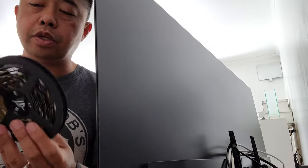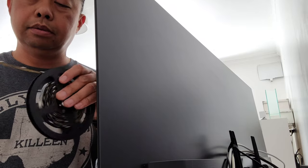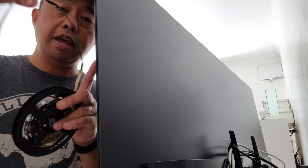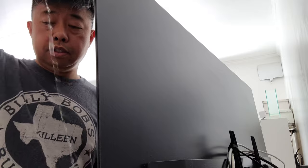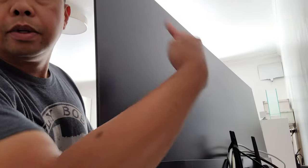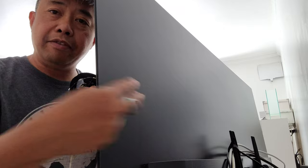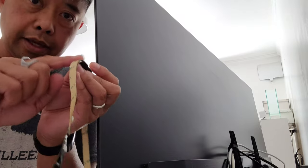The first thing you want to do is make sure you've cleaned the back of your television — just take a damp cloth and wipe off any dust or grime so you have a nice clean surface to work with. Next, take your reel and carefully unwind the LED strip. It comes in four different sections, each separated by a cable. These correspond to the corners of the TV. Find the long sections and the short sections — the short sections go on the verticals and the long sections go on the horizontals. Depending on the size of your screen, you may need to position them closer or further in from the edge.